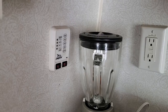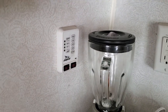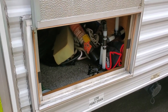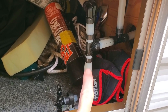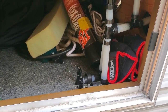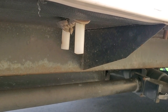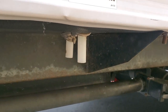The first thing you have to do is make sure your pump is off, and the hot water heater too, because we don't want any pressure on anything that would create more of a leak. This is the service bay — and these are the drains for when we winterize. This is where it's leaking out. It's not coming out in gushes, but going down the road we'd lose it faster because of the vibration.